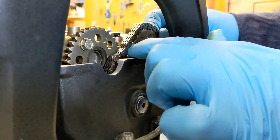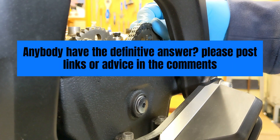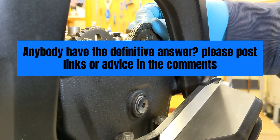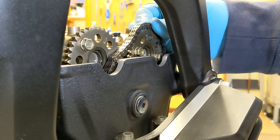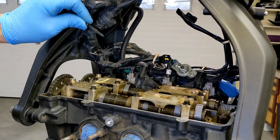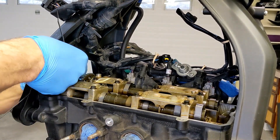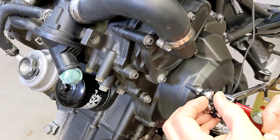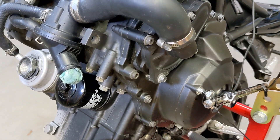Long story short, it's going to make it way more difficult to get this back together. I've been reading a lot of forums — the worst answer is the guy who says 'I just messed with it.' Other people talk about zip ties and gradually tightening the cam caps down. I thought about it all last night — there's got to be an easier way. For now I'm going to put one zip tie up here, take the cam chain off, and tie it up before it falls in. I've reset my safety system to make sure the crank doesn't turn, and in the next video we're going to try to get those cam caps off.